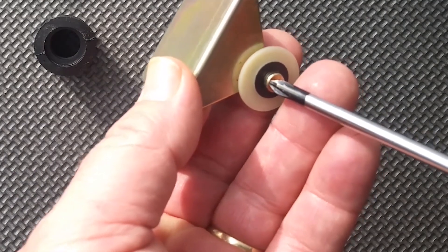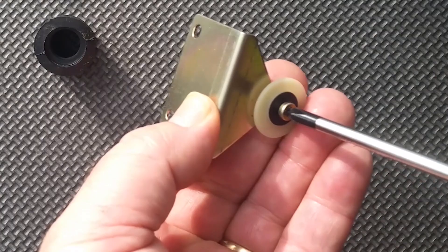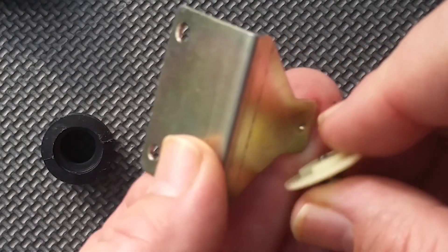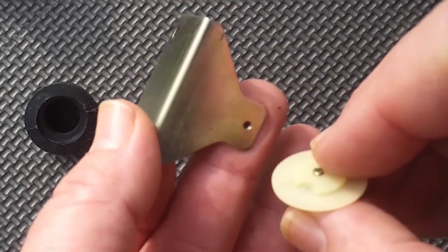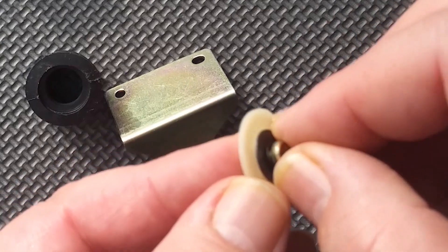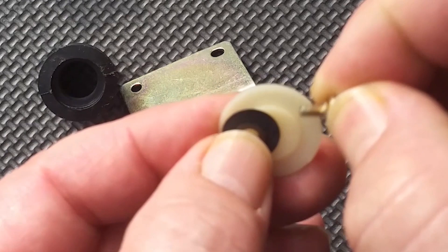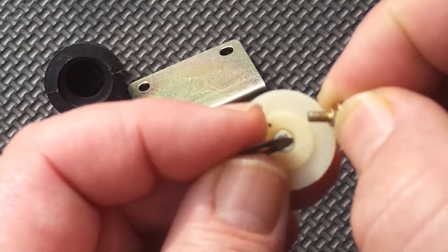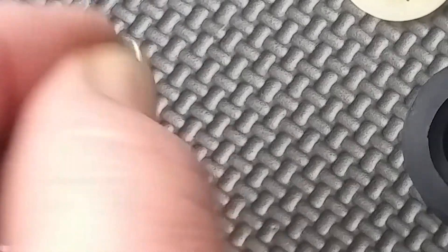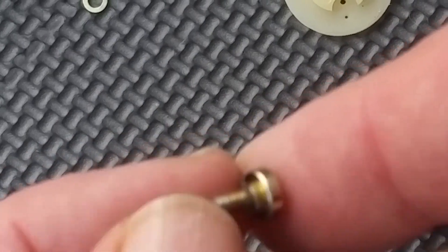Let's take the valve apart. There are a couple of videos on YouTube about flipping this valve over, but I don't see it. I've never seen one that's not flat, but I have seen them elongated where the holes stretched a bit. My thought is if you were to flip it around 180 degrees, you'd have a good seal again — or maybe I just haven't come across one that's cupped or weak. They all seem pretty much the same to me.